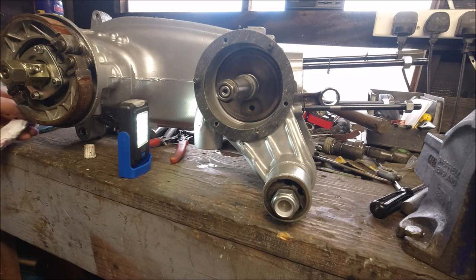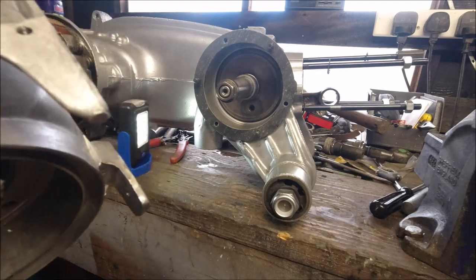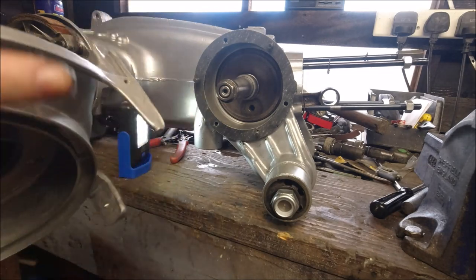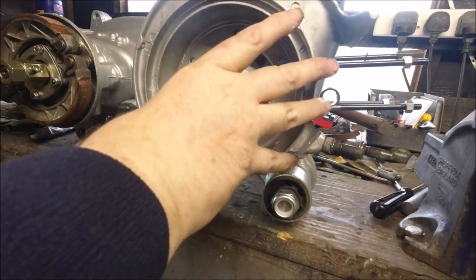I've built tuned motors with this gasket stuff and it always seems to seal. You see horror stories where people have done a lot of machining and everything's leaking during their leak-down test. In my opinion, if it's built properly it shouldn't need a leak-down test, but it is something I will be doing on this engine because I've never used these oil seals before. Just making sure there's a bead of grease on there, level with the crankshaft. Turn that over because the engine's upside down.